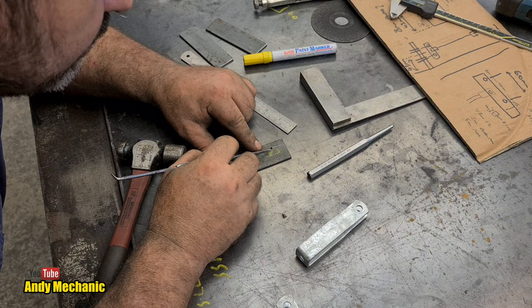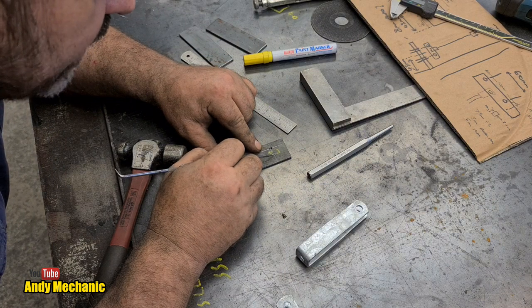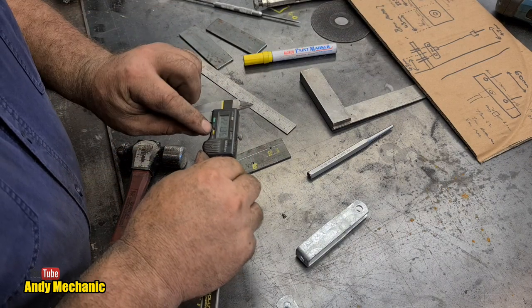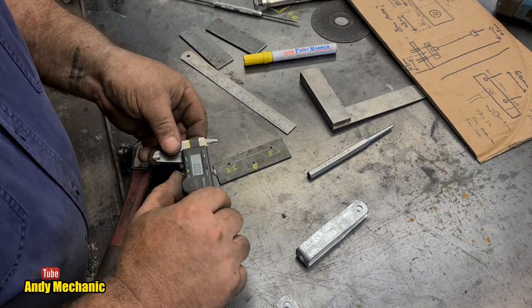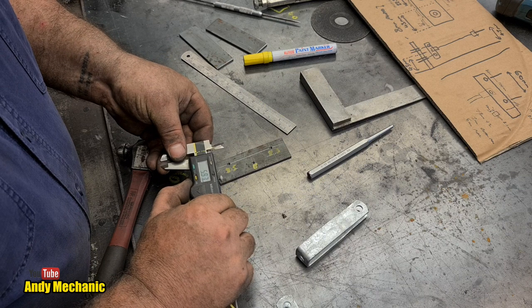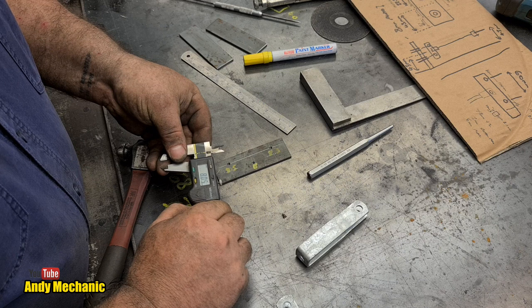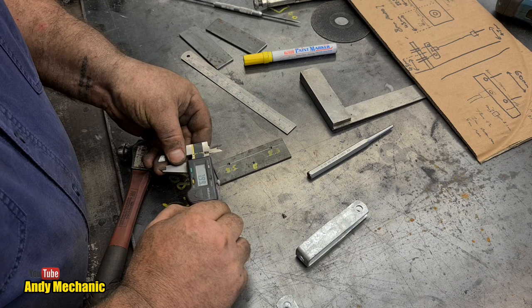I wonder, actually. Thinking about it, by the time we've drilled that out to an 8 and we've got a bolt head, that's too close. We need to back it off. Okay, design D. So it was 12. Let's go for 8 to give us some room, because that'll still leave 5mm of steel after the bolt.